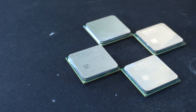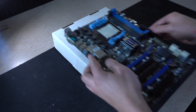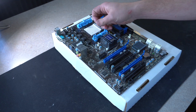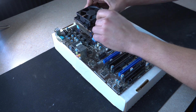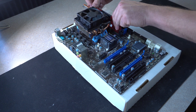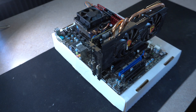I ended up getting four Athlon 2X4 640s with the GR designation. The first CPU I tested was a dud — it would not unlock the dormant cores, which meant they were unstable. Strike one. The second CPU showed some promise; once in the BIOS and with cores unlocked, it did show all six cores, but no matter how much voltage I applied, it would not get into Windows. It was simply not stable. Strike two.